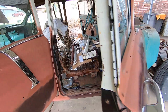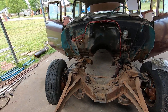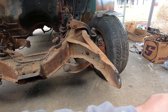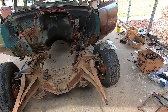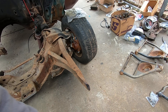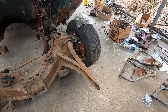Overall the car is great — no underbody braces that are rusty, the back side of the rockers aren't rusty. I did notice the frame has damage up here, so I did some cross-measuring on it. Pretty much the brace section on both sides is where it needs to be, but this one end is in a little bit — it looks like it took a hit this way because the fender on this side of the car has been replaced. I'm thinking about cutting this off right where this part comes in and meets this section.